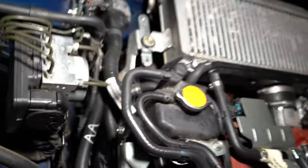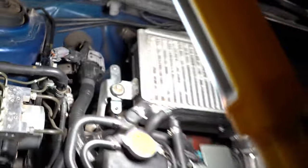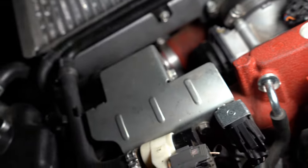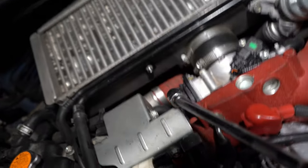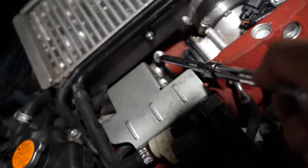Whenever you want to get to the downpipe, you really can't get to the downpipe bolts until you remove the top mount intercooler. Let me grab this light real quick. What we're going to do is take out that bolt right there, this one — we're going to unbolt that on the actual turbo connection. And right in there, there's a clamp that you have to take a flathead to and undo.